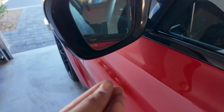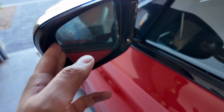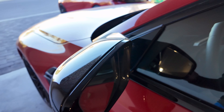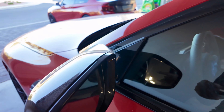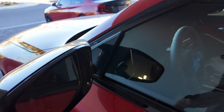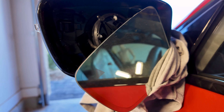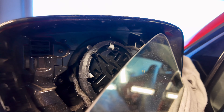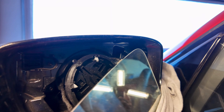So I'm looking up some DIY videos and hopefully I can get this right. What you do is put a prying tool right here, push up, and use your hand as well for the mirror to pop off. That's what I'm gonna try to do — hopefully I don't crack it, because if I do I'll have to buy another one. All I used was the pry tool, pushed with a little gentle force, and the mirror came right off.